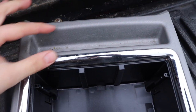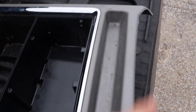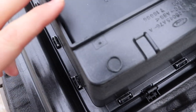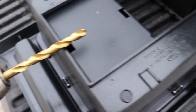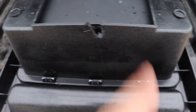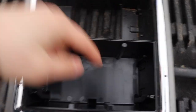If you have this, it's going to be closer to the tray at the front — the front two cup holders closest to your navigation screen or radio. Flip it over directly like this, and you see this hole here — your wiring is going to feed through that hole. So if you want this to mount flush and snap back in like factory, you're going to take your Dremel or drill bit and just drill it out slowly right there until it sits about flush with the bottom of that tray. I'll start mine and show you what it looks like when it's done. Then once it's done, you're just creating a little notch there for that wiring to seamlessly feed through without creating any kind of fitment issues with your tray going back in. So now that you've got that notched out, reinstall your tray.